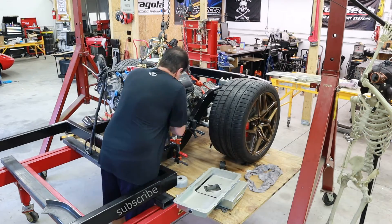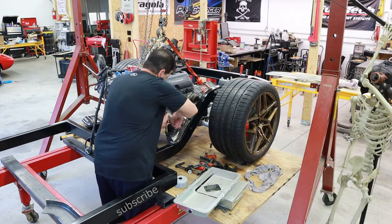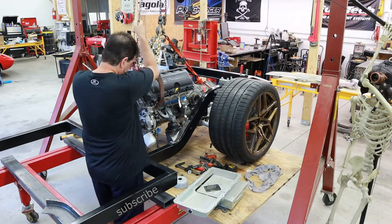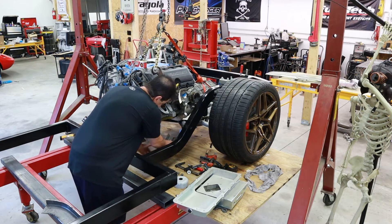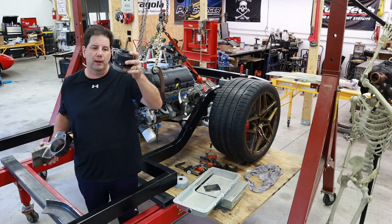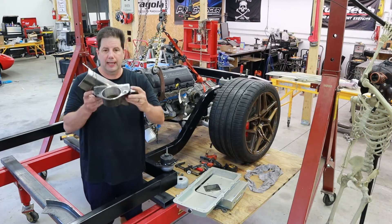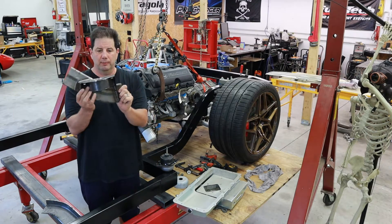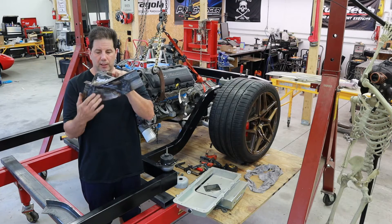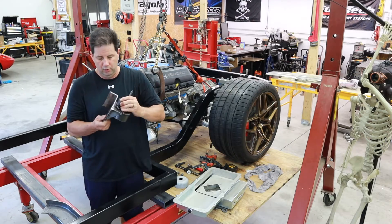So I ended up using that — basically what I did was, as you can see from this side, I cut them and then I split them. I took that split part and basically mirrored it on to where it needed to rest in the 45 degree angle, and then built a motor mount off of that. Let me go ahead and pull this motor mount off so you can kind of see it a little bit better. This is the actual Ford motor mount — the Ford performance unit out of a Mustang — and here's the motor mount I came up with. One side looks more like a traditional mount, kind of squared off and boxed off with a four inch hole. This is a four inch pipe, and then the other one is the frame rail that I cut open, so it just drops right in here and really works out pretty nice.